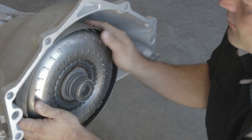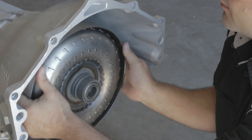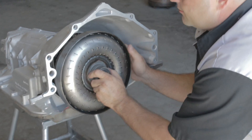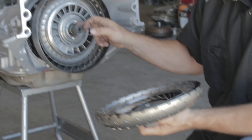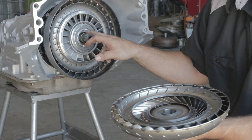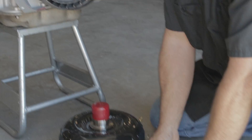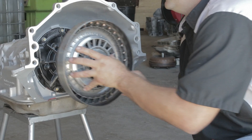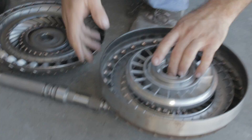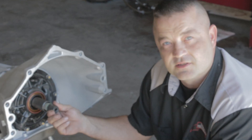When we're trying to put it together, we're actually not locked in with the impeller yet. But when this tries to slip onto the O-ring, that's where it becomes difficult to get the converter to lock in. It occurs at approximately the same time as the impeller hub is locking into the pump gears — that's where most often customers think the converter is in because it feels bottomed out, but it's not.